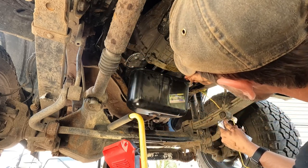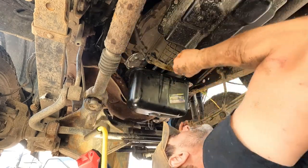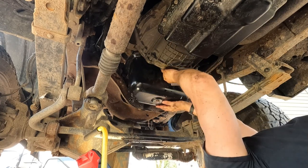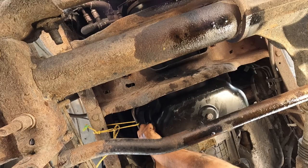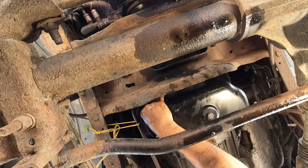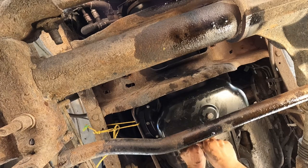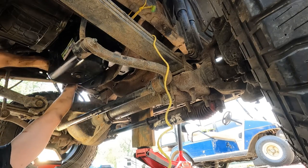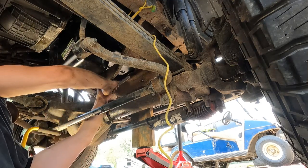So I'm putting on the gasket sealer on the rear part of the oil pan now. Just an extra layer of protection. I used a 3/8 inch ratchet extension and swivel to get the 5 or 6 screws in on the oil pan above the large cross member that the motor mounts connect to.